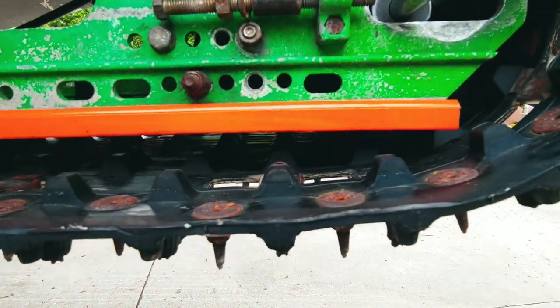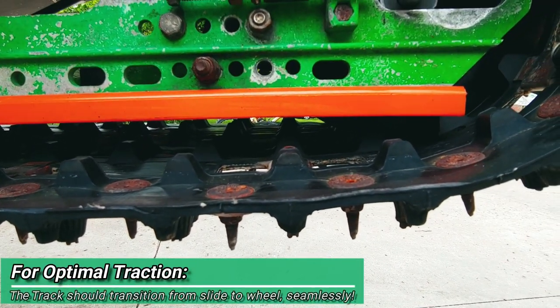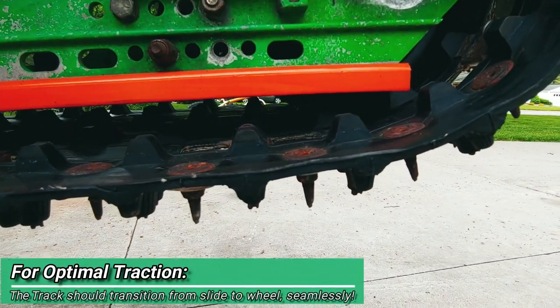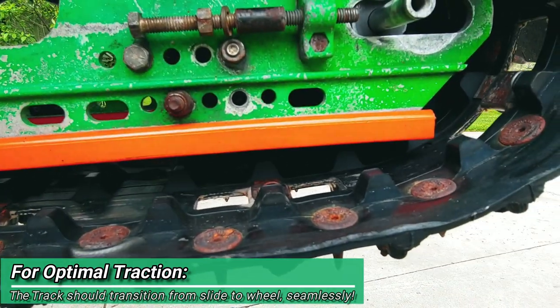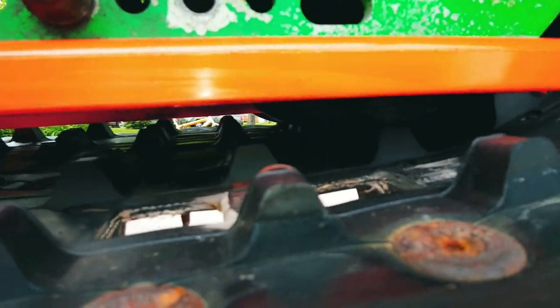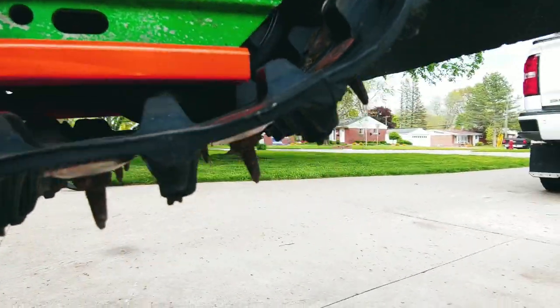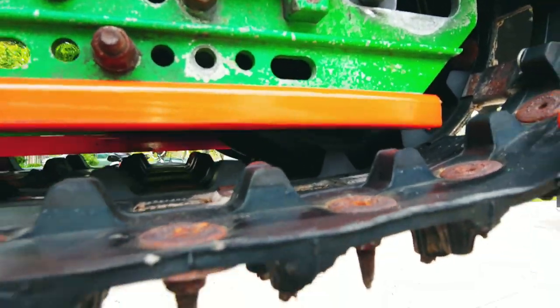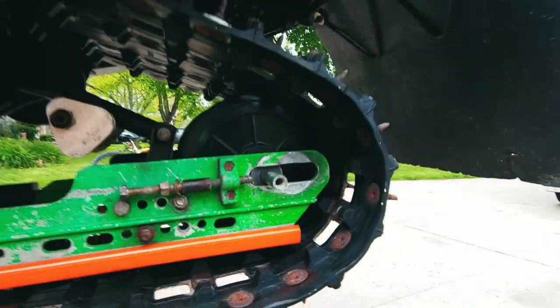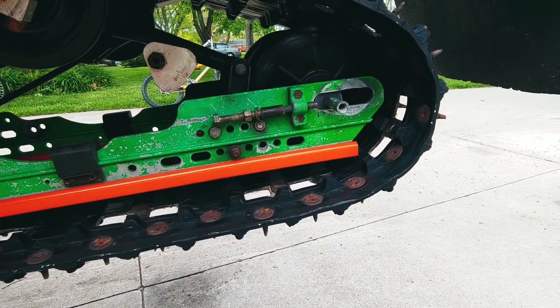What happens is you get about 3/4 of the wheel sticking down below the Hyfax. It's kind of hard to see now, but anyway, you can see where the wheel is. They're all sitting pretty far down, so I wanted to fix that. I wanted to leave the big wheel kit on there. That's the way I got it.